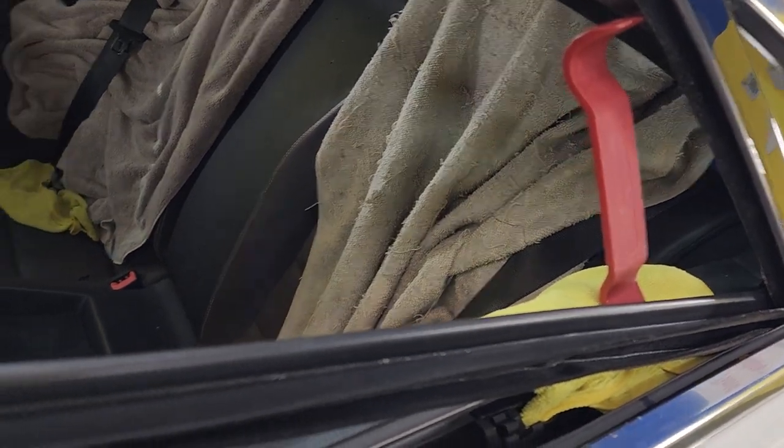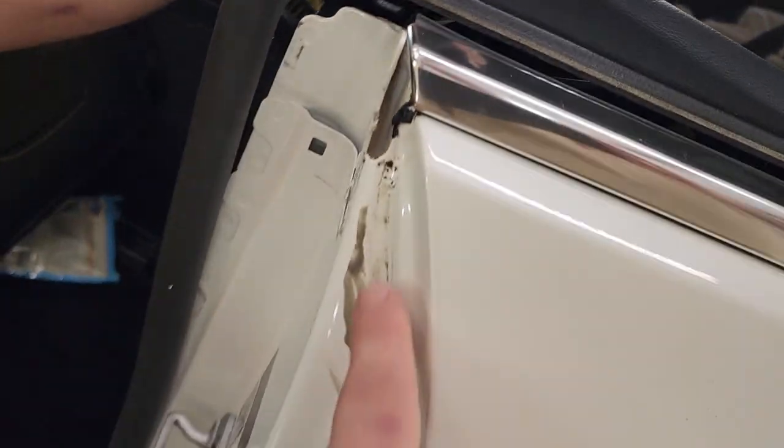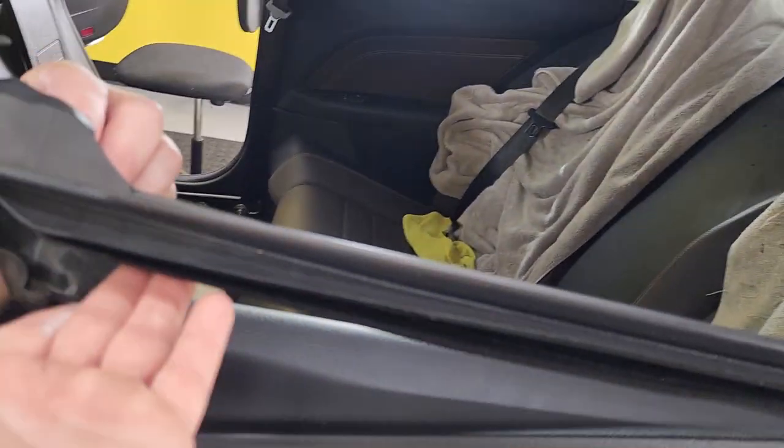See how Tint Specialist Brian here took the seal out. Basically all you do is just undo the double-sided sticky tape here, push a little pry back here, make sure you're protecting their interior and then this will pull out. Why do we want to do that? Well look at that tight, tight corner in the back.